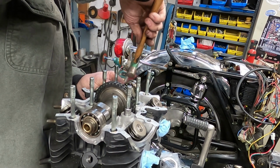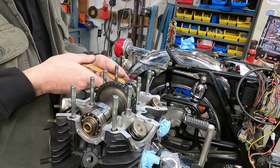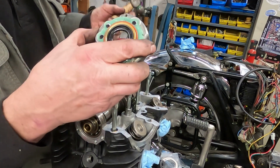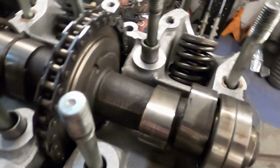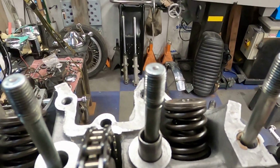But one thing you want to make sure of is that you put these bearings, and I'll show a little closer up here, right on the edge on the inside, so that when you put your caps on, these slide in, and there's enough room for that lip to slide inside that groove area. What I'm talking about here is, you can see right here, there's a little bit of a lip. That surface right here should be back here so that you have a nice gap around both sides. So when that cap goes on there, that's basically what holds everything in place.